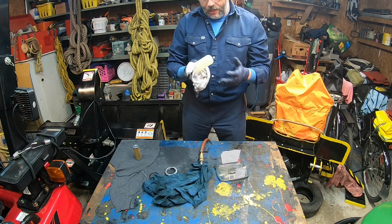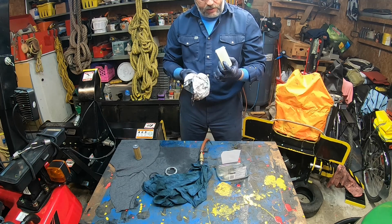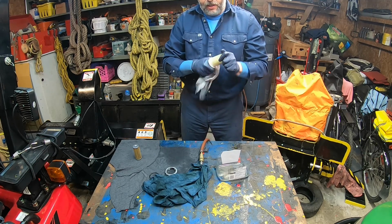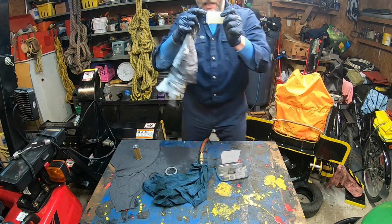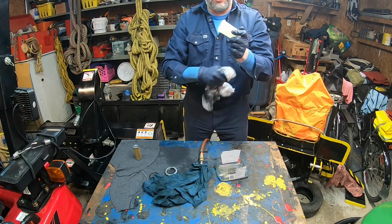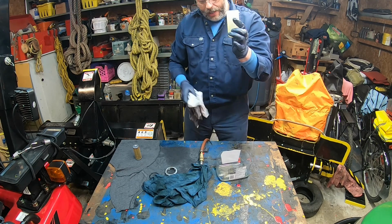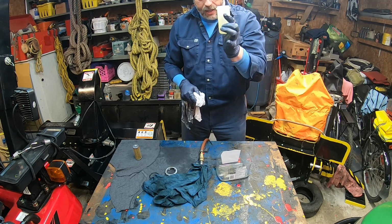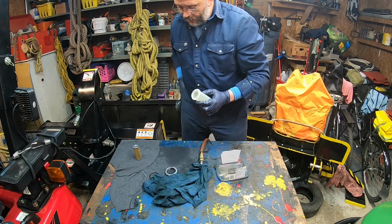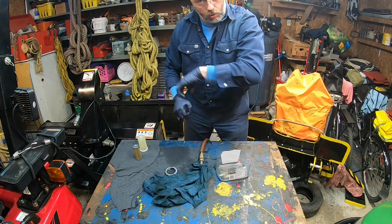However, like I say, this is the outside of the bowl, so it's exposed to dirt and stuff like that. But do a good job. It's worth it. All right. So the lip here, that's where you want very clean because that's where you're gonna put the new O-ring coming up with the fuel filter, which is right there. All right. Now I'm gonna put that rag in my pocket in here. You put it inverted so no dust will go inside.